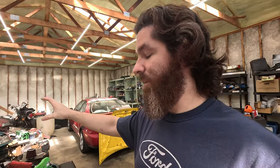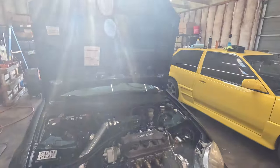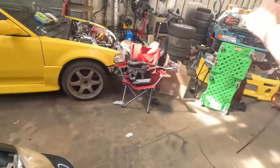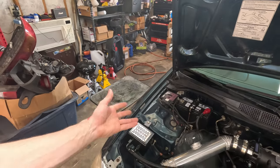This engine I built a little differently than Carlos's motor. We didn't bore it, didn't resize the cylinders on that one, so we had a lot of piston-to-wall clearance, and that's most likely why that piston failed. This one has 0.0035" piston-to-wall clearance all the way across, a tighter ring gap — 0.018" top ring, 0.020" second ring — and it has almost no blow-by. Catch can lines are a little higher than Carlos's so it doesn't push as much oil into the catch can. Yesterday I cleaned the catch can lines and there was only brown water — just moisture.